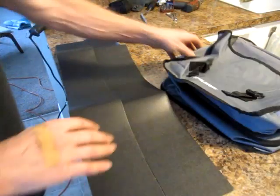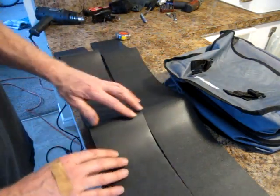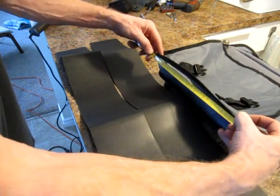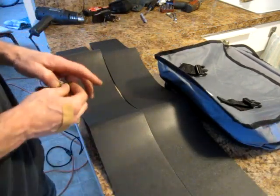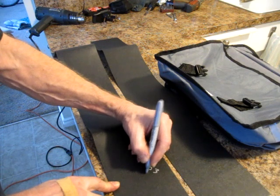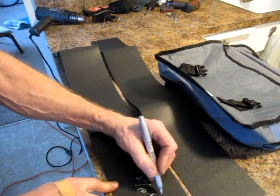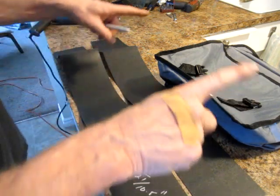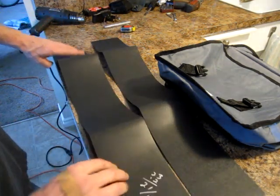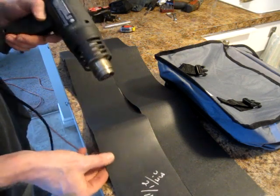The saddlebags came with these plastic inserts. They were just sort of folded over like that. But I think I want to put a sharper bend in. It's approximately 1 foot across the bottom of these. These are 33 inches long. So 33 minus 12 is 21, 10.5 inches per side up, which is about right. But I think I'm going to heat these up to take these sort of shipping bends out of them, and then make a mark and make a nice crisp, almost right angle bend.